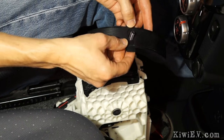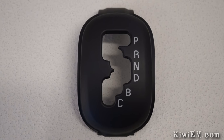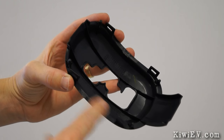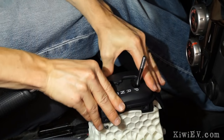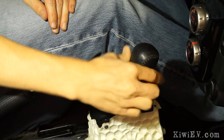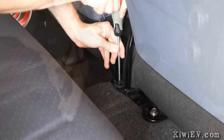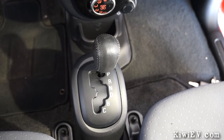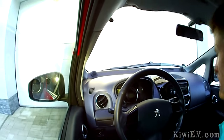In the meantime, put the shifter slider back into place in preparation for the new shifter plate. Though you may find you need to cut off this clip on the new shifter, as it has a different place to this clip on the old shifter. I filed my clips off on each side. Now all that's left to do is clip the shifter plate back into place, reattach the gear knob, put the center console back into position, and replace the two screws and plugs that you took out at the beginning. And that's it. It really is that easy. It's so easy it makes you wonder why they did it in the first place. And the only question remaining: what do these new gear positions actually do?